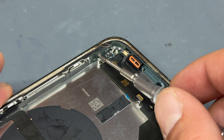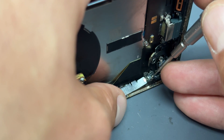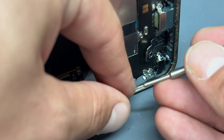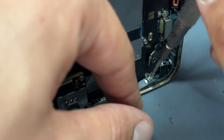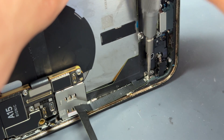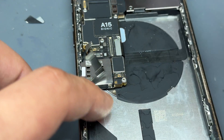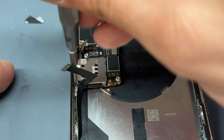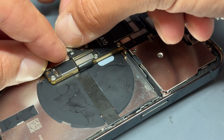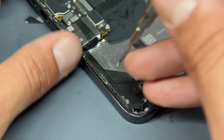There's a standoff screw and a small tri-wing screw in the right-hand corner. Moving over to the other side, there's one more tri-wing screw that's going to be a bit awkward to get into place because the cable is a little springy. Once they're lined up we can screw that in. Then there's the cable that folds around the corner with two little tri-wing screws that hold it down — push the flex in and get it secured. Then get that other connector attached with one more tri-wing screw.